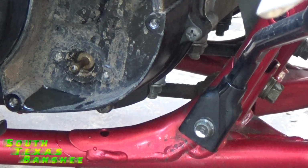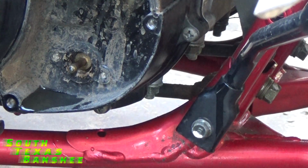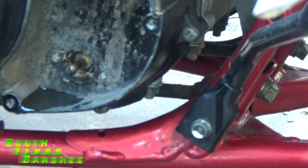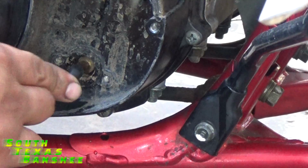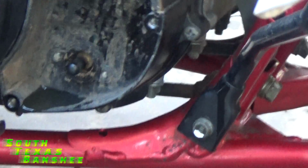is you go down to the parts store and go to the help rack and look for a vacuum plug assortment, and they look like this. Little bitty rubber caps. They have assortments for like $4 or $5, all different sizes in there. So take one of those, get a small one that'll fit good and tight, stick it over, push it all the way on, and you're done.